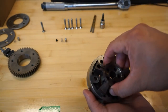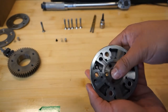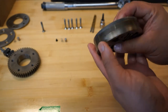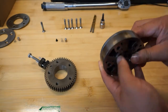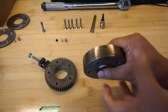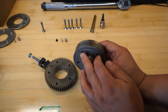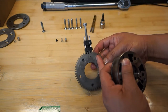Start reassembly now. The inner vane goes through the slot where the keyhole is. Check for function — it's pretty good. Before we put this in through the lash gear, the orientation is usually: find the part number, look for the two adjacent holes, and those two holes correspond to the two holes on the lash gear.